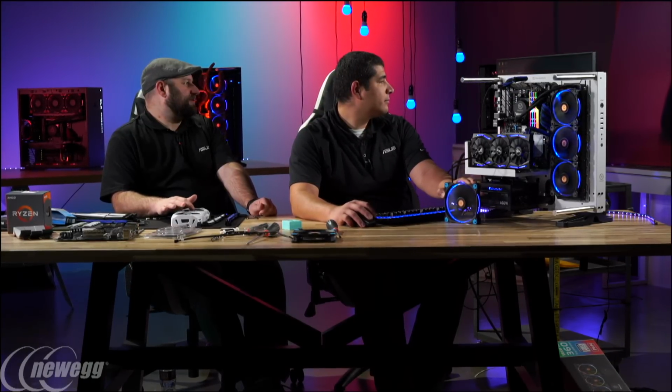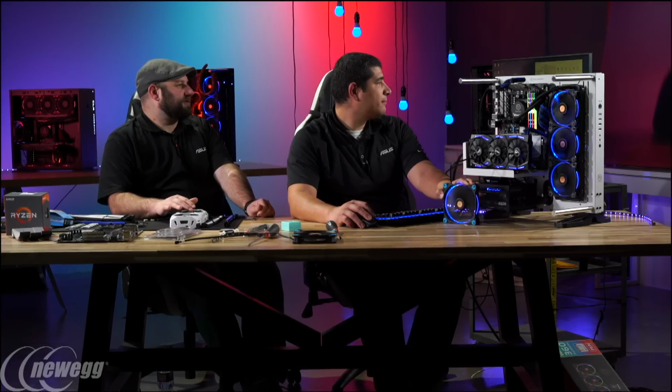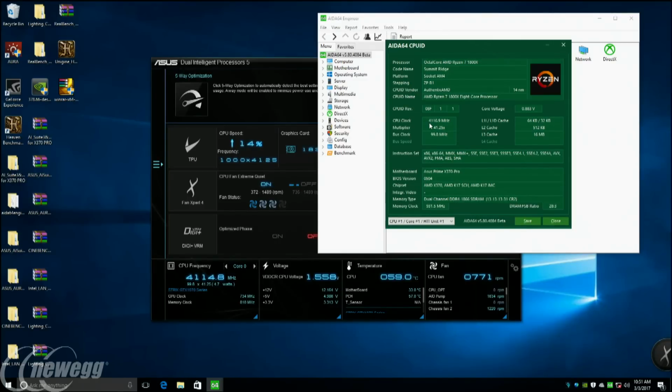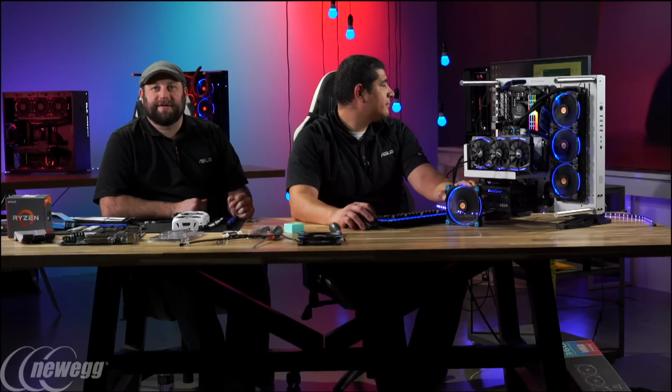Also, for people that have just tuned in, we're overclocking on the new Ryzen CPU. It's the 1800X. That's the 8 core. So we have 4.1 gigahertz. We ran the auto tune, our auto-tuning software, which is part of our 5-way optimization suite. And it found that the maximum that this thing can take is 4.1 gigahertz on all 8 cores.